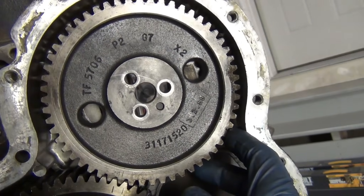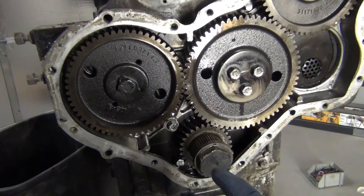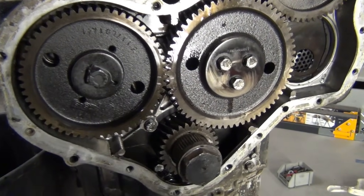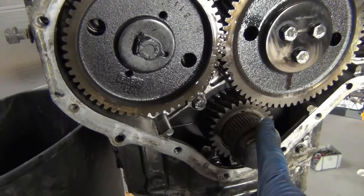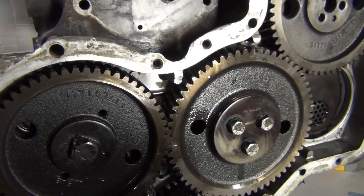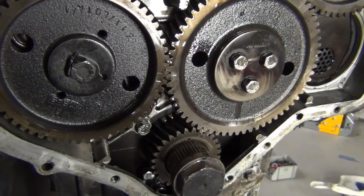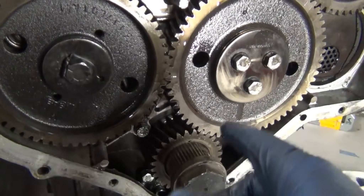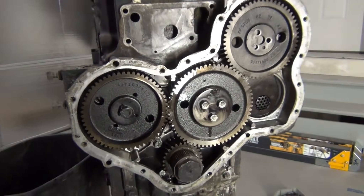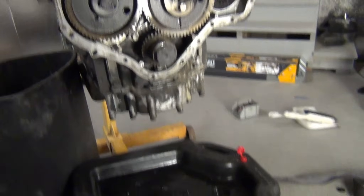I've got to hold it because my injector pump's off naturally. If you're doing these, you have to rotate this a couple of times to get them to line up. If I rotate this over again, this has to rotate so many times for how this does. But this is the one to watch. So if you rotate this around a couple of times, this will go around once or whatever. I think two times for this is one of that, and then this has to go a couple of times before it lines up with that. It's not going to fall into place on the first try unless you're like some lucky half-full bottle flipper that lands on its face — then it might.